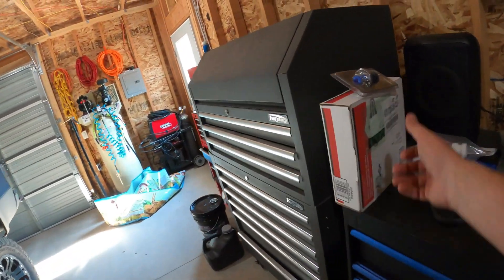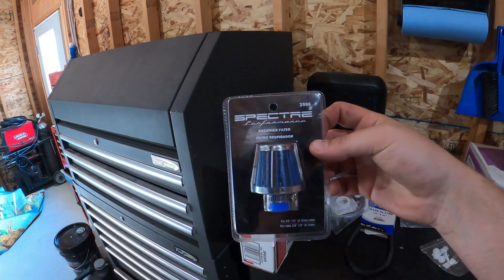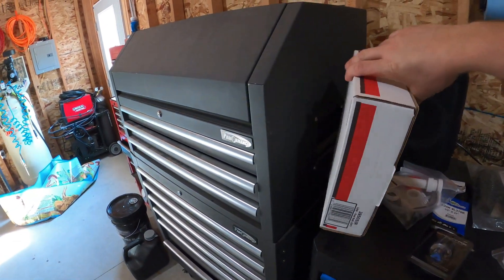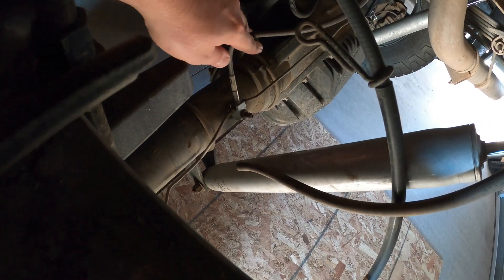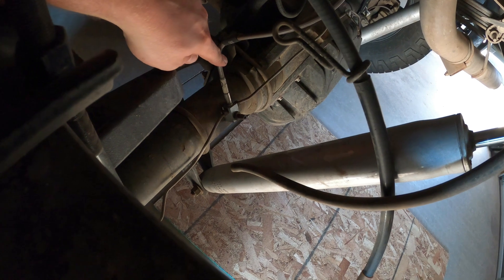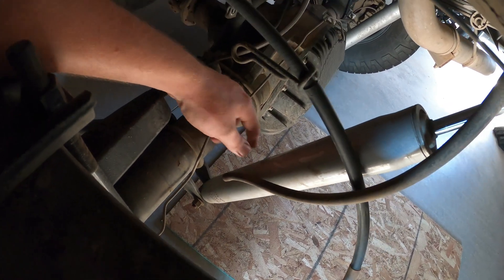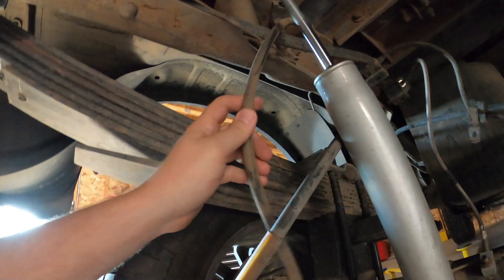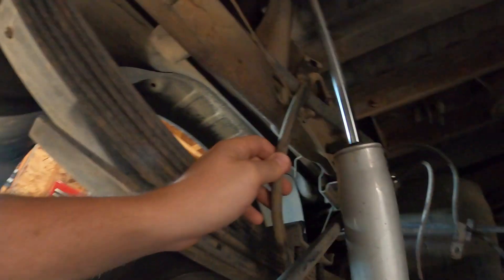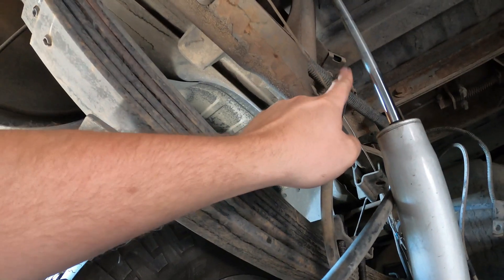We're going to do the same thing in the rear. I bought another filter — these are insanely expensive, not sure why I went with those, but I bought that and some hose. I'll link both in the description below. In the back here, if you crawl over your driver's side leaf springs, you've got your brake hose and then your breather hose, and this one is so old, dry rotted, and brittle it's just not staying on anymore. From the factory, these breather hoses just end right there on the frame, which for 95% of everybody is fine.